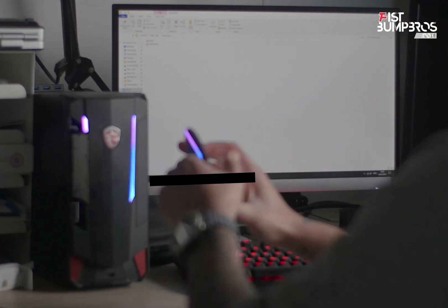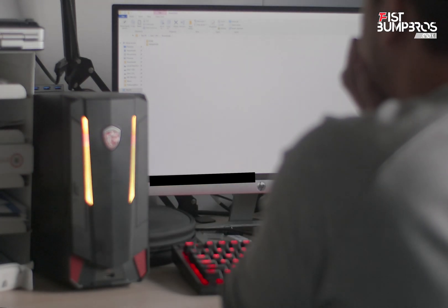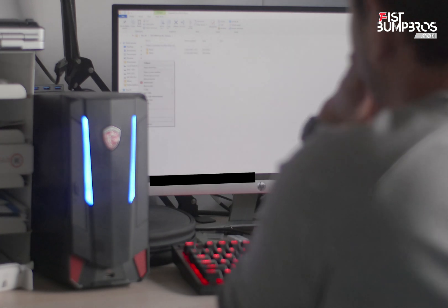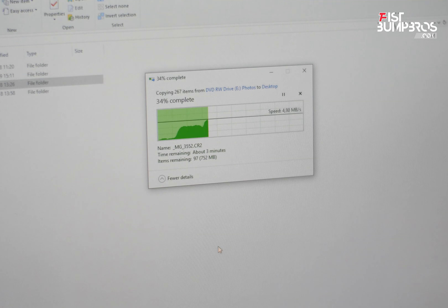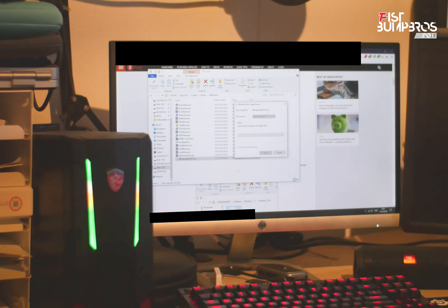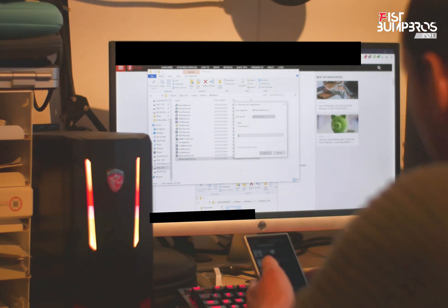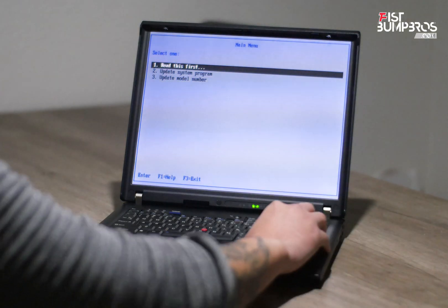Luckily I own a desktop with an optical disk tray. I tried many times to erase the DVD — it did not work. The DVD-R was so heavily damaged that it took 29 minutes just to transfer over 1 gig from the DVD-R to my hard drive. So I ordered a 5-pack of CD-R spindles from Amazon, and after a few days I got the CD-Rs and was back in business. I burned the BIOS update onto the CD-R, and it booted up perfectly.